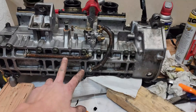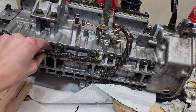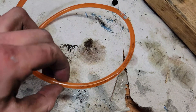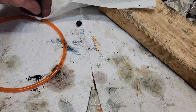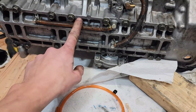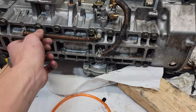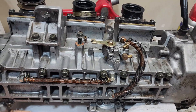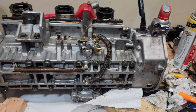One last thing before I put the engine back in — I'm replacing all the oil lines, because these are pretty old and get brittle. I'm using fuel line: 7/64-inch inner by 1/4-inch outer, which you can buy by the foot at most local hardware stores. Make sure you get the clear stuff so you can see when there's oil flowing through and tell if you have a problem. The last thing you want is an oil line going bad on the bottom of the engine and having to pull the whole thing again, so just do it now.